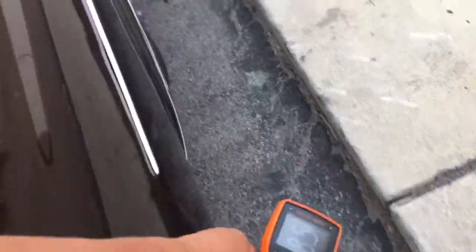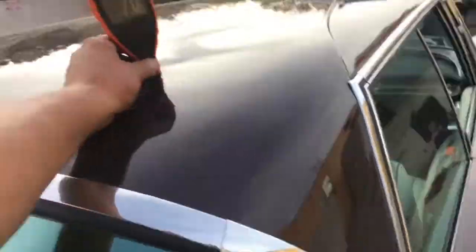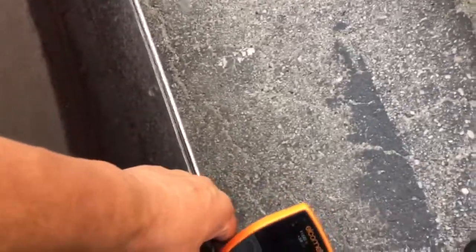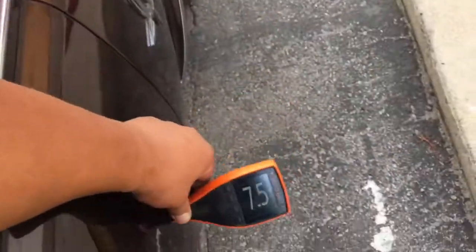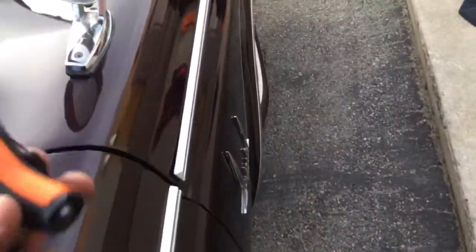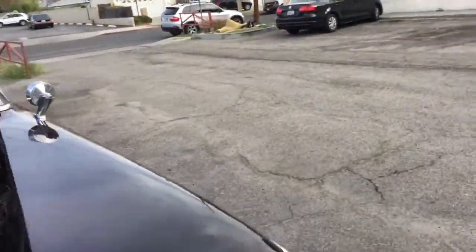Going to the other side, checking the back: readings of 8.5, 10.5, 10.5, 8.5, 7, 6, 12, 12.5, 9, 7, 7, 7.5. Looks like we might have some body filler in the lower right rear door — getting readings of 4, 6, 8.5, and then 20 — so some body filler down there, but not too much. Further readings of 8.5, 9, 7.5, and more body filler on the door at 18. For the most part it's pretty straightforward — just a couple of panels that picked up on some body filler.